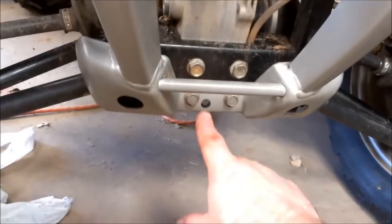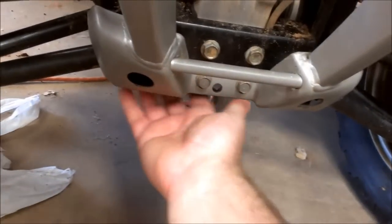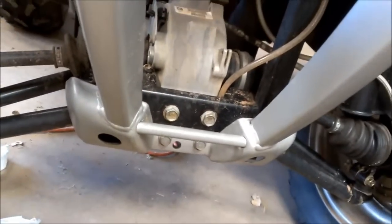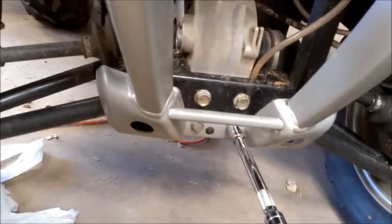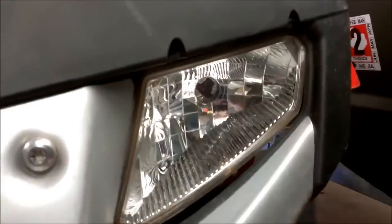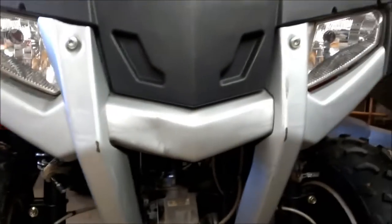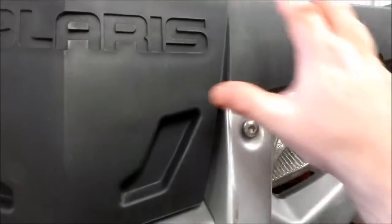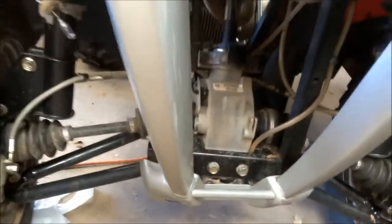The first thing I'm going to do is there are two half-inch bolts down here, and these are not nutted on the back side, so I'm just going to take those off with a half-inch ratchet. First thing you want to do is there are wires that go to bulbs inside both your headlamps. When you take off the front brush guard, those front headlamps are hooked into this black plastic piece, and this black plastic piece is going to come off. So the first thing you should do is take these bulbs out — I didn't show that prior to the half-inch bolts, but those bolts are now out.